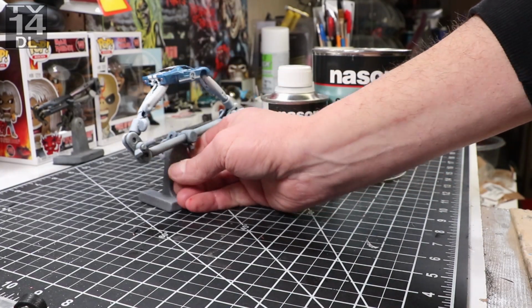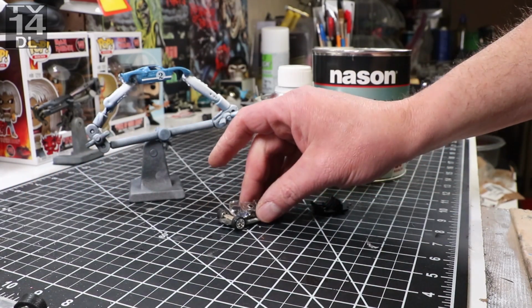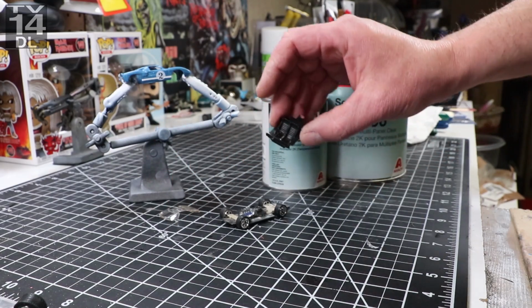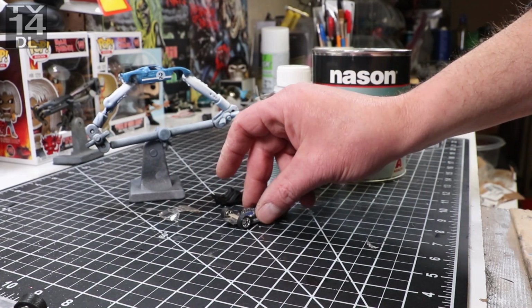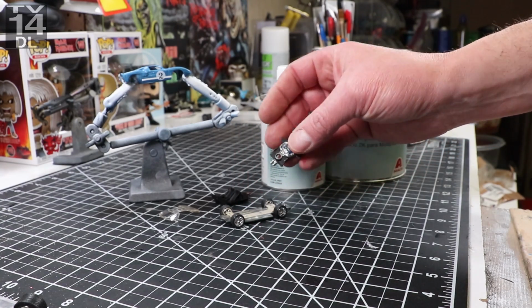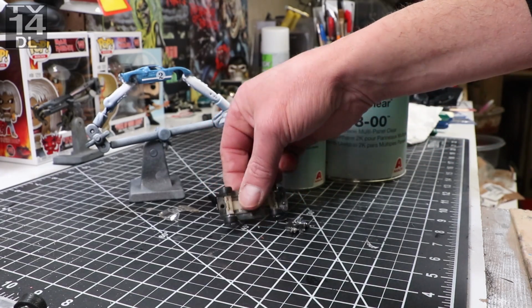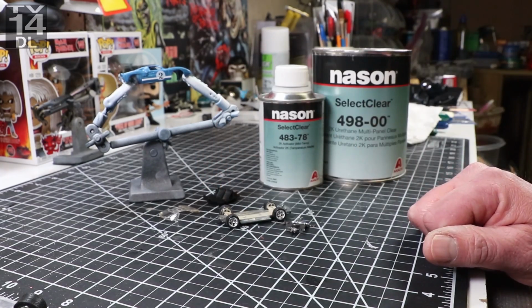And there you can see my clear coat in the background, and that's what I use, which is an automotive 2K clear. And really, at that point, now it's just a matter of clearing it and assembling it. You can see I painted the interior black. I get rid of that ugly red. I wanted to go white because I thought it would stand out a little bit more, but a white interior is not really practical. In a race car, it would have been black, so that's kind of what I'm doing there.